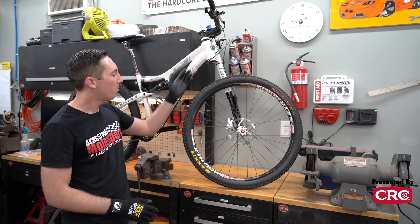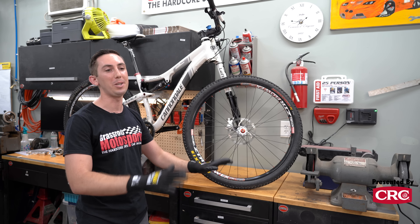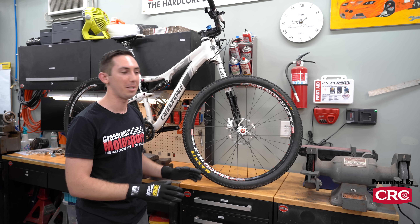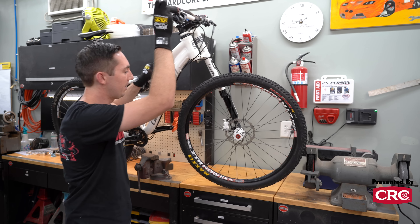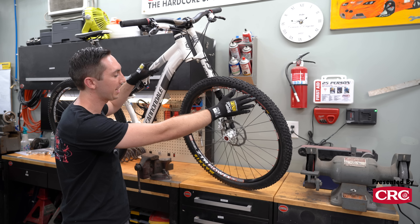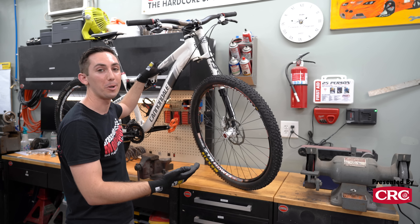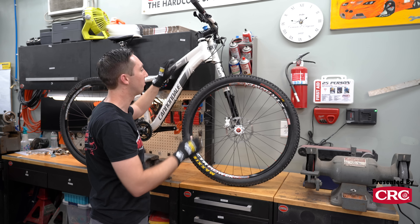This is my bike, and what we have here is basically a McPherson strut front suspension if you ignore a couple links and make a couple logical leaps. We talked about static negative camber, which is basically just leaning the bike over more — and as you can see, the tire is leaned over more, that static negative camber. But we have another way we can add more negative camber when we're in a corner on track, and that is caster.